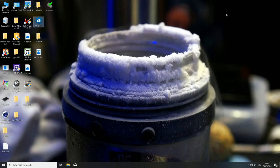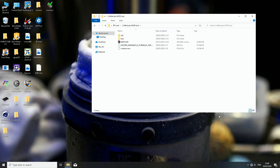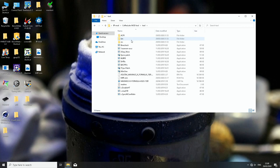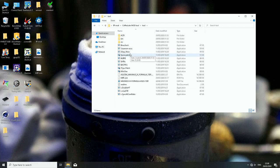So now it appeared on the desktop, so we have M9F.rom. Now one thing, as I will be using a P0 stepping 9700K, the latest version of this tool didn't work out for me. The latest version is from December 2019, so a very recent one, but it gave some weird issue at the GOP-VBIOS procedure. So it always failed.